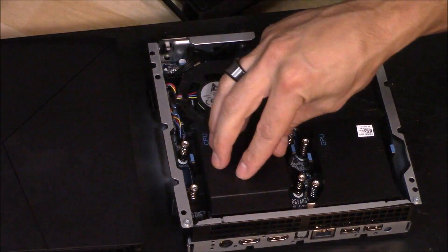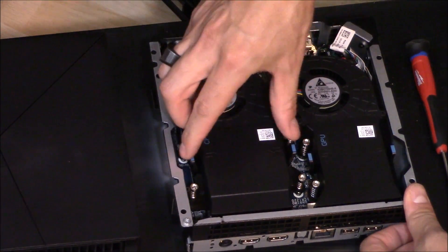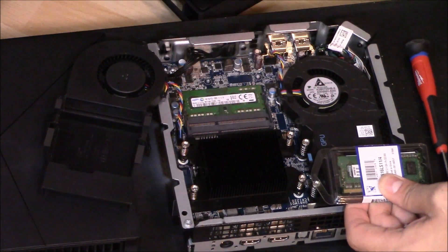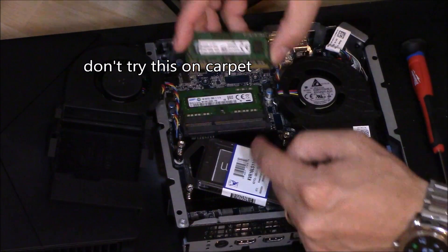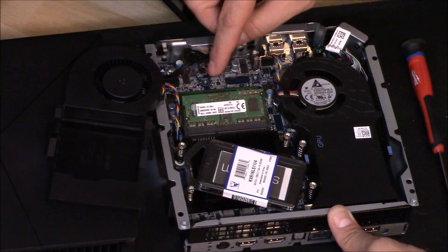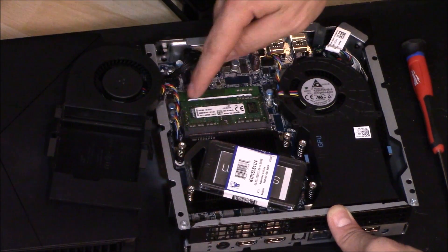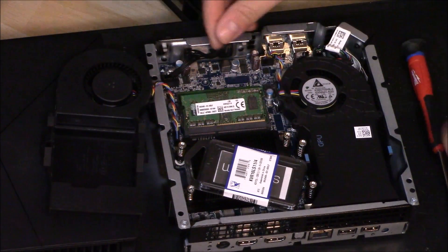This is the CPU, this is the GPU. You want to take off the CPU fan — just squeeze it on the sides and pull right out. And right here are your RAM slots; there's room for one more stick. Grab it by the edge — I usually don't touch the copper part. This is very easy to install: put it in this way, push it in downward, and let it do its thing. You'll hear it clip and latch on. To take it out, just pull these tabs apart and it pops right up.